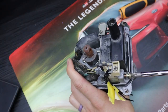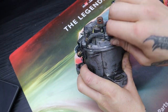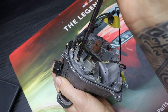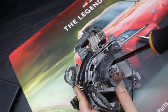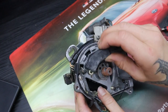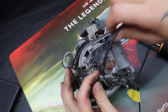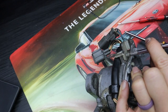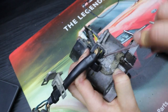Now I'm gonna remove these two mounting screws that hold the coil in place on the distributor housing. Next I'm going to begin removing the igniter — I need to disconnect these wires, then remove these two screws to pull the igniter out. I'm now going to remove this first magnet, but it's not gonna come out just yet because it's all part of the same harness. Since I'm going to remove that wire harness soon, I'll go ahead and remove this little distributor cap seal right now too and get that out of the way.